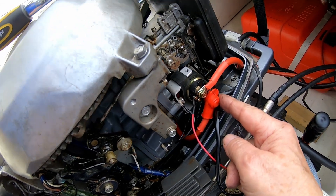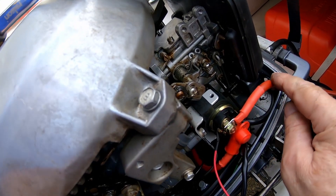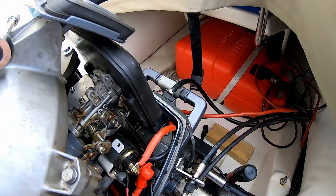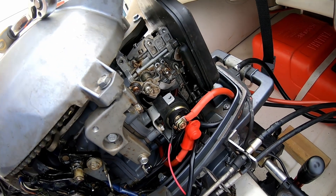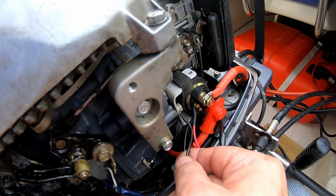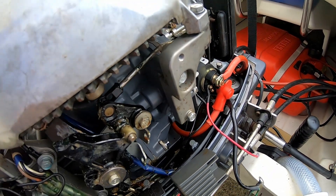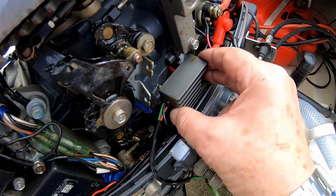I've fastened up the positive to the starter motor. It still goes through, and both the battery cables are heading off underneath to go through and underneath the seat, which is under the cover at the moment. We forecast good weather but unfortunately there's dark clouds gathering so I'm reluctant to take the cover off. What you might notice is that I've taken the solenoid negative, put it under the bolt of the bracket and onto the engine. That's the positive for start, going through on that 5-core cable. I've got the voltage regulator here — the idea with that is it's going to go down there.